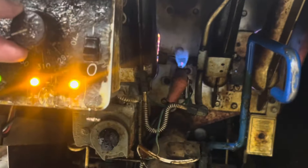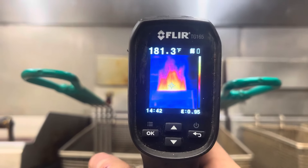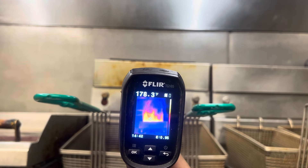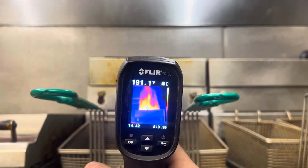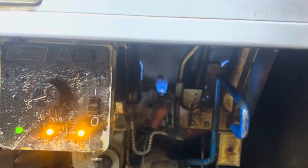Now I'm gonna wait and make sure it hits 350. I'll show you something pretty cool. Alright, this is what I wanted to check — I turned it to 250, and it is 250. She shut off now. It is 250, ish. And it's satisfied. So I know my thermostat's right. That's the response to that.